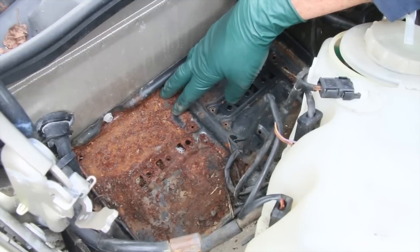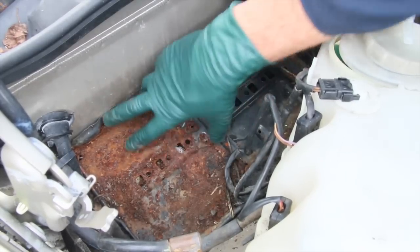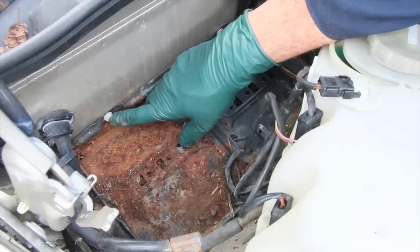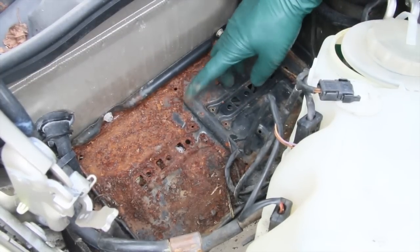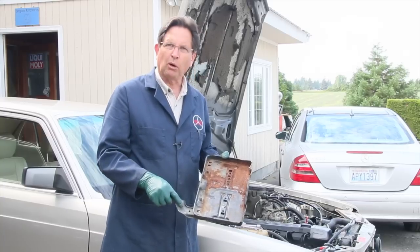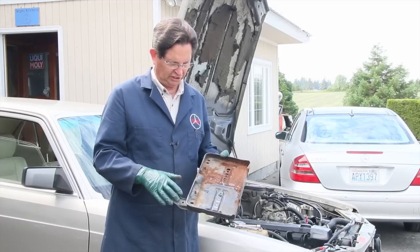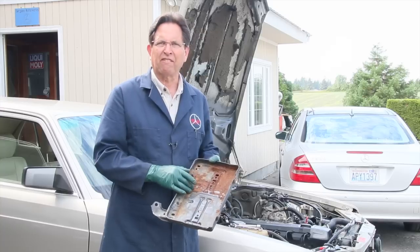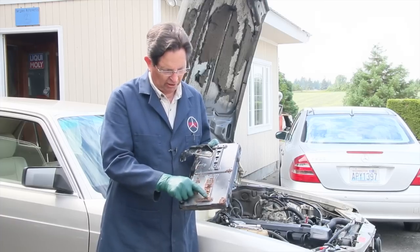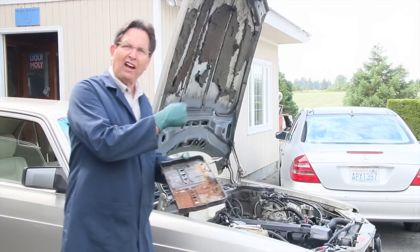I'm not surprised because I've seen this a lot, even on 1990-1995 models. Classic example — if you don't take care of this, it's going to rust completely through. And when you see rust this bad, there's going to be problems underneath. Most of these trays are held in with a couple bolts and maybe one or two nuts, so we're going to remove those now. If these are badly rusted, you may have to grind them off. This tray actually had three bolts and one nut, with a bolt on this bracket hidden underneath the window washer tank. Look at it — we have a tray that's about 50% rusty on this side.